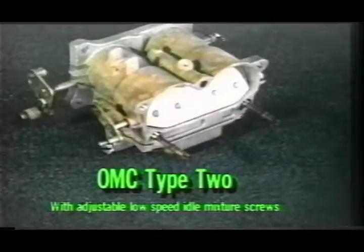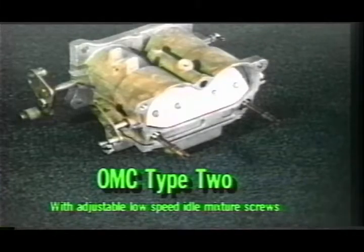The other thing I want to discuss is the difference between our Type 2 and Type 3 carburetors. Presently we're working on a Type 2 OMC carburetor that has adjustable low-speed jets. The one I have here in my hand is a Type 3, which has fixed low-speed, fixed intermediate speed, and fixed high-speed jets. The OMC Type 2 carburetor has low-speed idle-adjustment screws on the front of the carburetor and fixed intermediate and high-speed jets. It was found mainly on the Johnson & Evinrude 85 through 125 horsepower engines.